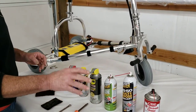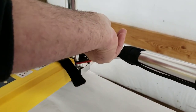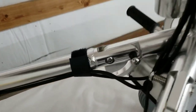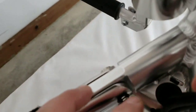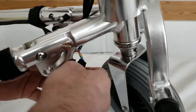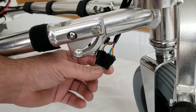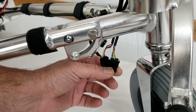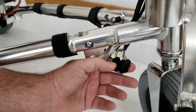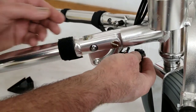The points on the scooter that can use a little dousing of that from time to time are your battery connector and your battery receptacle. Push forward on your little latch to open the junction box cover. Apply the spray liberally to your two connectors — your on-off forward-reverse connector and your throttle connector. While you're down here, make sure the connectors are secure, that none of the wires are damaged, and that the wires are firmly inserted into their plastic connectors.